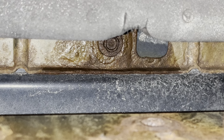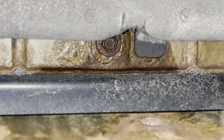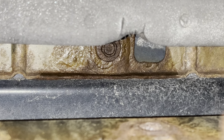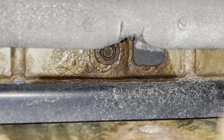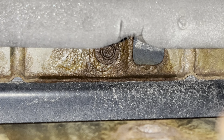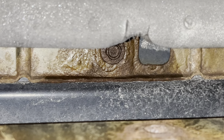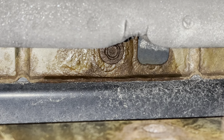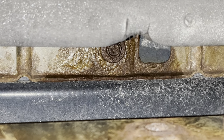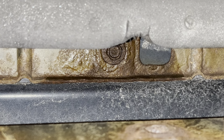Underneath the car, I do have a trailer hitch, so I'm using two extensions on my socket wrench. Those are 10 millimeter heads. These are the bolts that are very likely going to be corroded and rusted, so when you put your socket on that bolt, you want to push up into the vehicle as hard as you can when you try to break it free. I'm going to spray a little lube on there to help loosen those up — I do not want to snap those. There are three of them underneath the car.